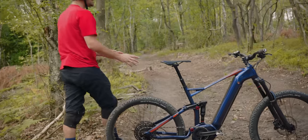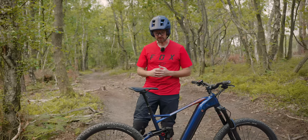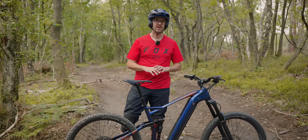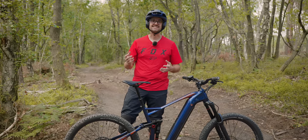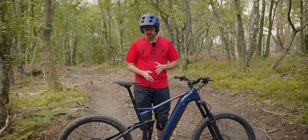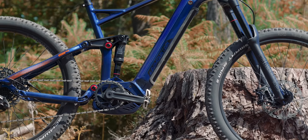Let's talk about the geometry a little more. This is an XL, and the geometry is a little bit weird, especially if you're a taller rider. The chainstay is really long — 485mm — and there's a reason for that. The guys on EMTB forums have dug deep into this bike and identified that this frame, although it's a Decathlon bike, is shared across different brands that use 29er wheels, selling for between 5,000 and 7,000 euros. It's a standard frame shared across manufacturers, some speccing a 29er or a mullet setup. The reach on the XL is really short — around 465mm — and there are no charts published to confirm it.